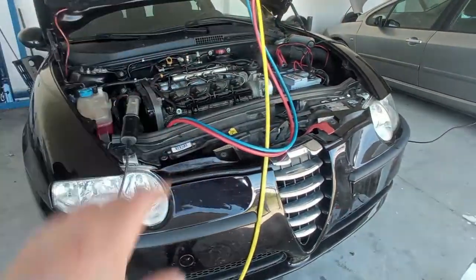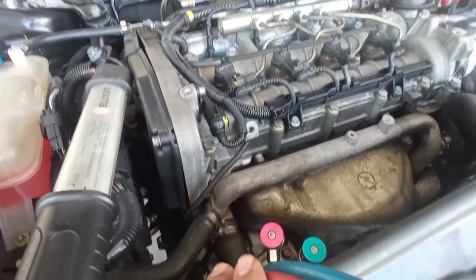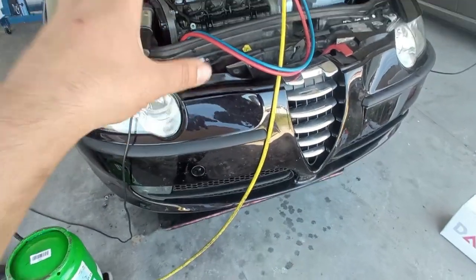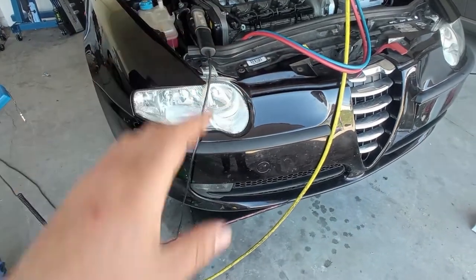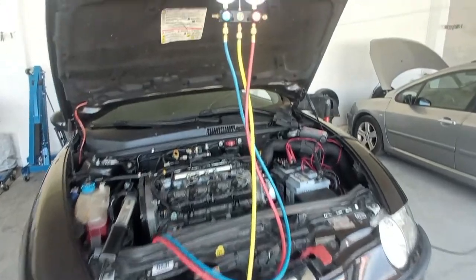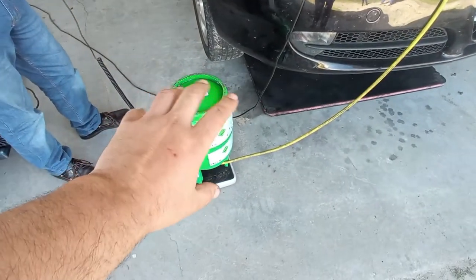So we have here this Alfa 147 to do the replacement of the AC compressor. It's being replaced. I already have a very complete video for that. It is down in the description, so you can see how it is done. Okay, so we already did the vacuum over here. We are doing the test of the vacuum as we speak. And next we are going to put the freon in.